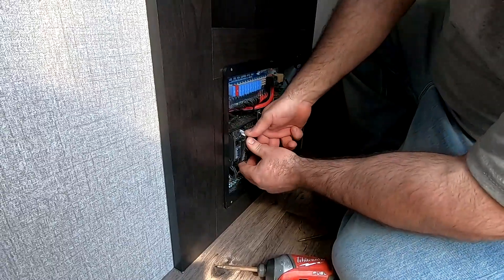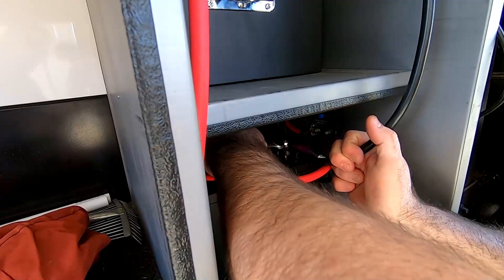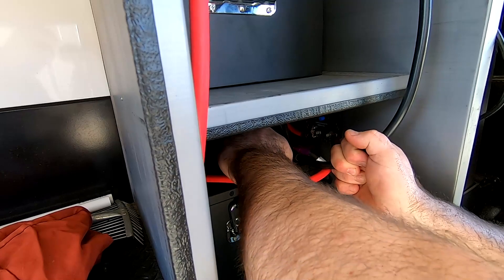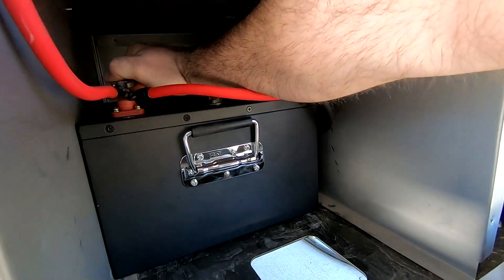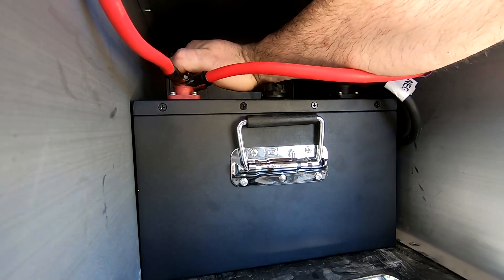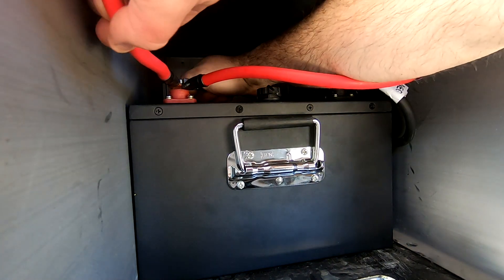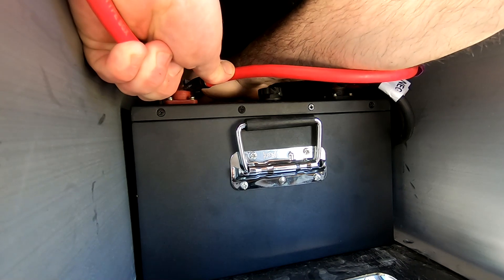It's also going to increase the charging volts from 13.9 to around 14.5. The maximum voltage on the batteries we have is 14.8. You cannot put this in series or in parallel with lead acid batteries, and realistically you're going to want to put this in series or parallel with the same battery so you have the same battery management system running both batteries. With all that in place, you can put the new batteries in, connect everything up, and make sure everything is secure. Check the metal thickness of everything you're putting these batteries on to make sure it can hold that 60-some odd pounds that's going to be bouncing around.